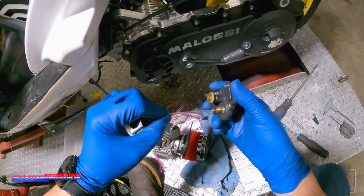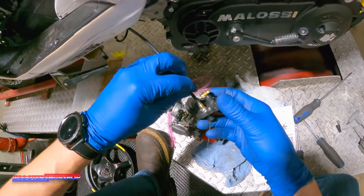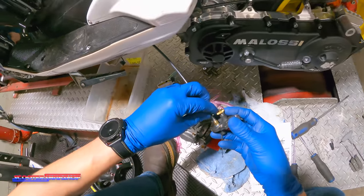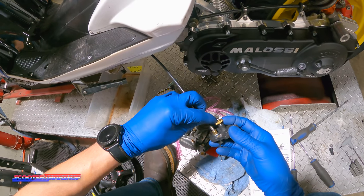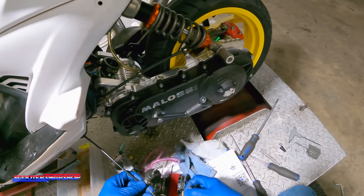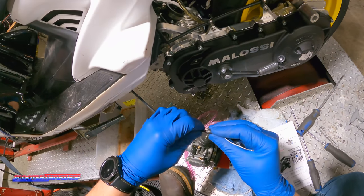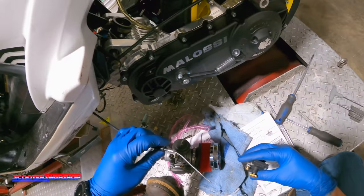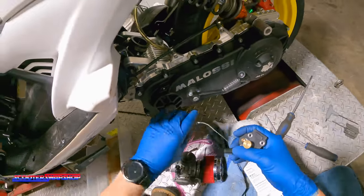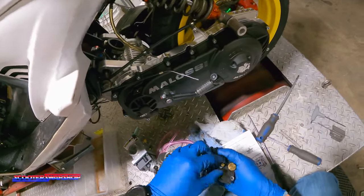So what happens sometimes if you guys are hanging out, you're riding wheelies, right? This is going in and out, in and out, in and out, just like this. And what happens is you drop the slide. This comes up and it catches just like that. Now your slide is pulled up. So it is important. I say that and I think about how many of my bikes do or do not have this piece. Let's see if that one's gonna be tight enough. I may have to get a different one. Yeah, that's too loose. So we're gonna find another boot to adhere this to this piece.